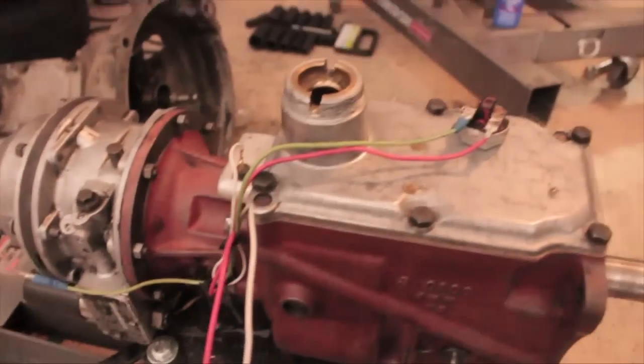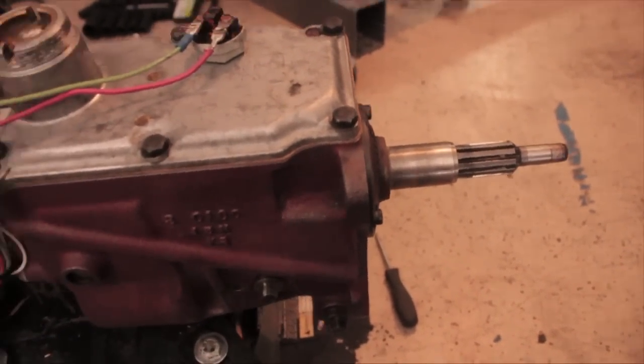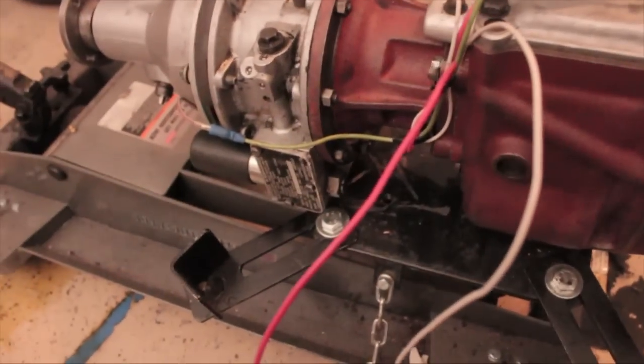This transmission is ready to put in. Unfortunately, my jack stands don't put the car high enough to use my transmission jack, so I'm going to have to just muscle it. I've got the bell housing connected with the throwout bearing in the middle — be careful not to knock out that throwout bearing when you do this. Otherwise it's pretty straightforward. I will have a jack underneath to support the weight of it while I get it up there.